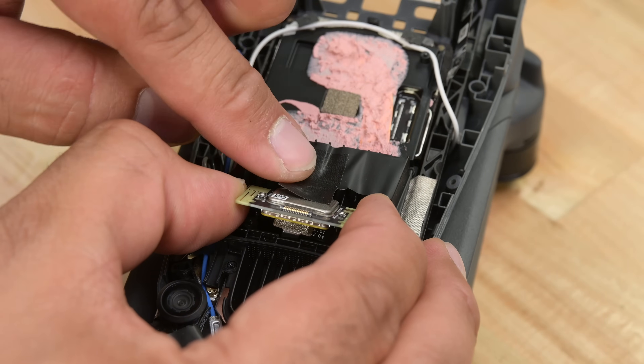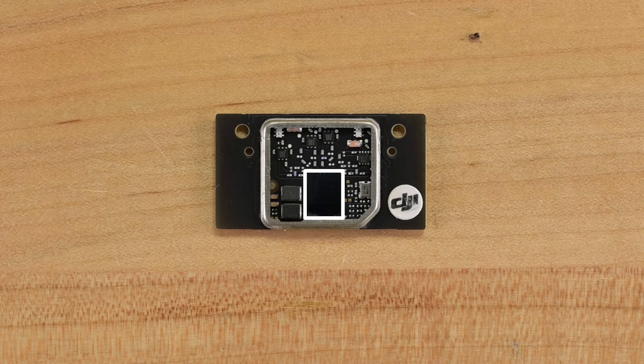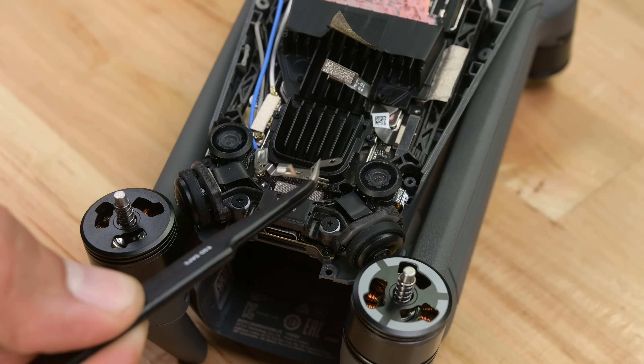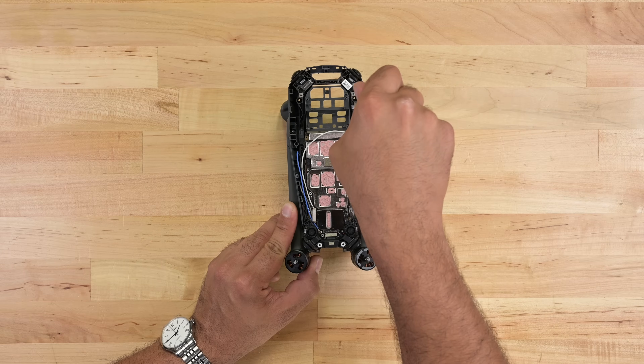Here's the drone Bluetooth and wireless connectivity module. That shiny rectangle is a Synaptics single-chip Wi-Fi 802.11ax, Bluetooth 5.1, and FM receiver. After more screws and brackets, I finally got the heatsink away, and several more screws and a few cables later allowed me to remove the front and rear camera assembly.